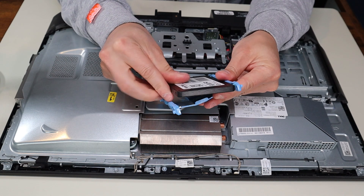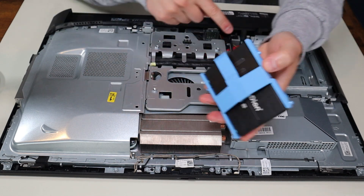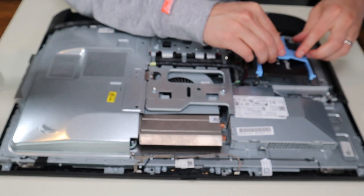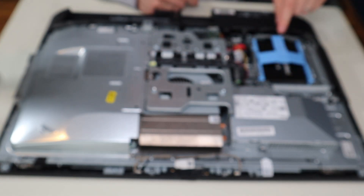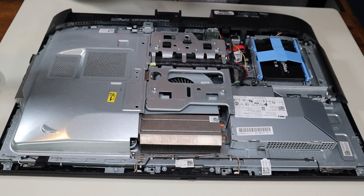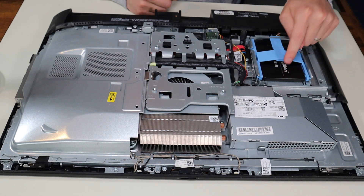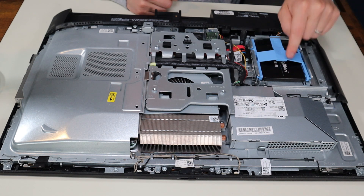To get it back in, you would just put those plugs into the holes, make sure the SATA port lines up correctly, lay it down, push this down a little bit to get it out of the way, and then pull back down to plug it in. I will have several 2.5 inch SATA hard drive and solid-state drive options for you below in the description in that link, with all the replacement and upgrade parts for this computer.